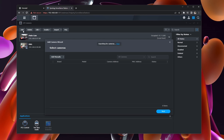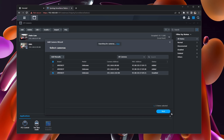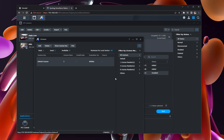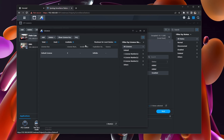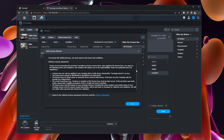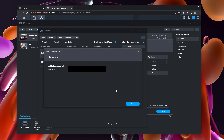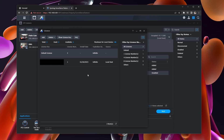Under the IP camera application, all we're going to do is click add, and here it's going to search for cameras on our local network. It's pretty good about finding these, though there are some situations you may have to manually input it. I just go ahead and click on the check mark and go next. You can see here for this third camera, it's saying I do not have the sufficient amount of licenses. So I'm going to go to the licenses application — you can see the default licenses here. I'll click add, agree to the software agreement, and then input the license key that came on the little card I ordered. It's going to go ahead and activate, and we can see we successfully added the license. It is a lifetime license on our local host source.